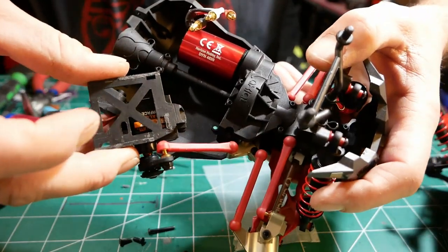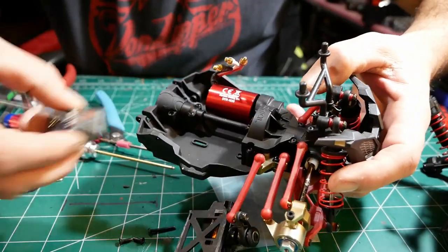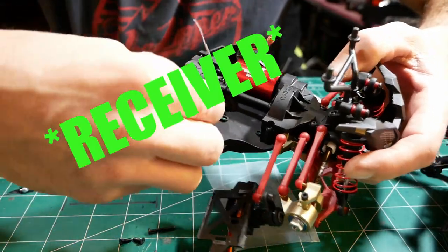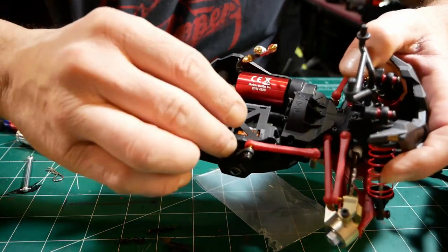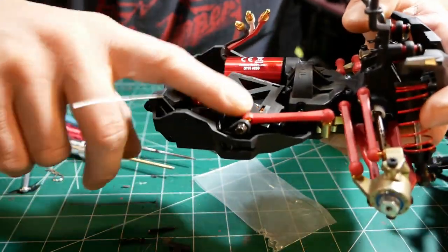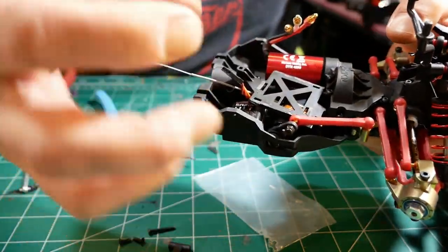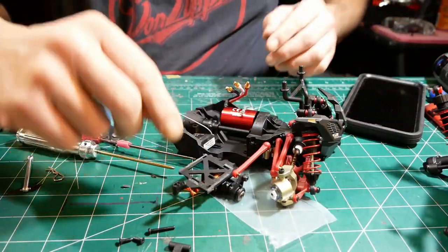So I've yarded out the old servo mount here on the bottom of the chassis, and we're going to take our SR215 servo, we're going to mount it right back here underneath, and then this guy's going to sit kind of over top of him like so. And then I cleared flat the top of this, all the mounts that held the stock went in, so we could put our electronic speed control on top.